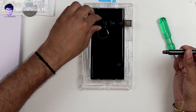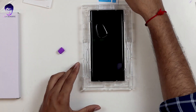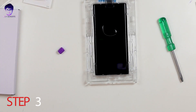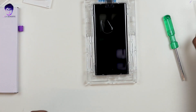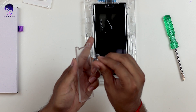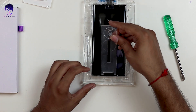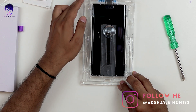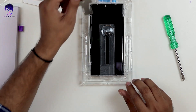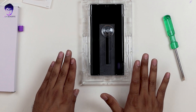Moving to the next step: remove the upper bridge and install the side tab onto your phone. Now place the tempered glass — remove the back protective film and place it firmly and evenly onto your phone, checking alignment. There is a protruding part and a plain part; install the suction cup on the top part, align it, and bring it down so the LOCA gel is centered. Once centered, remove the suction cup and let the LOCA gel spread. Do not touch anything — let it sit for two minutes so it spreads evenly.